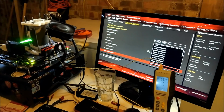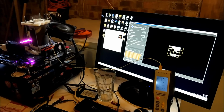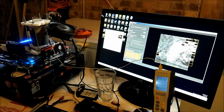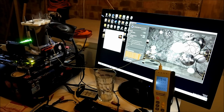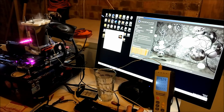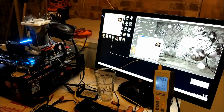I guess, so go back down to 3400, but leave the timings as they were. Let's try again. Minus 57.4 now, that's pretty chilly. Right, so going down to 3400 C12 seems to have worked pretty well there actually. And we're at 4.85 and we just got 2,226.